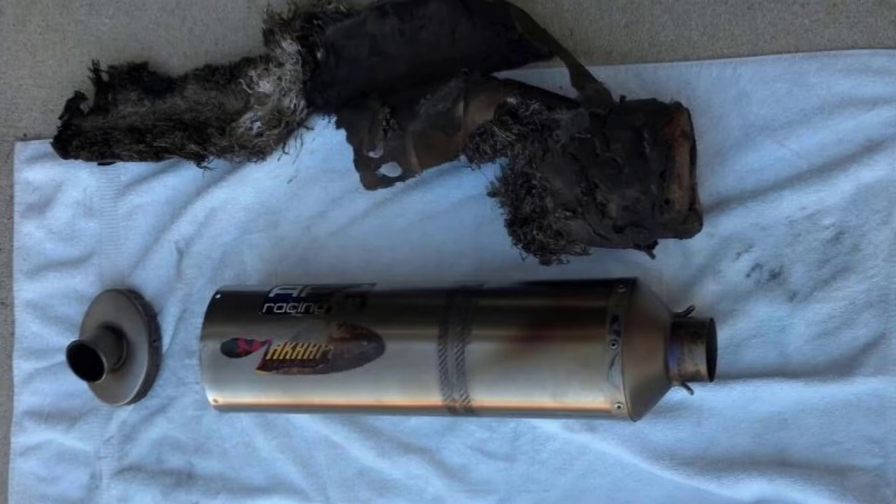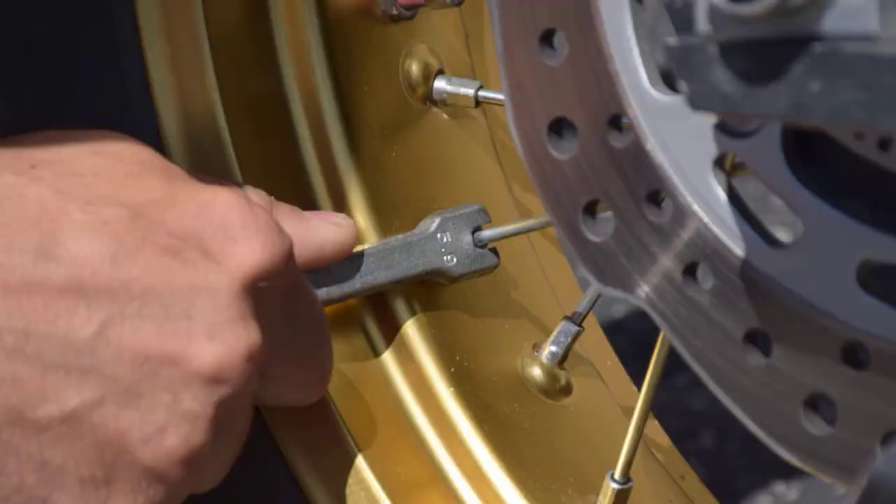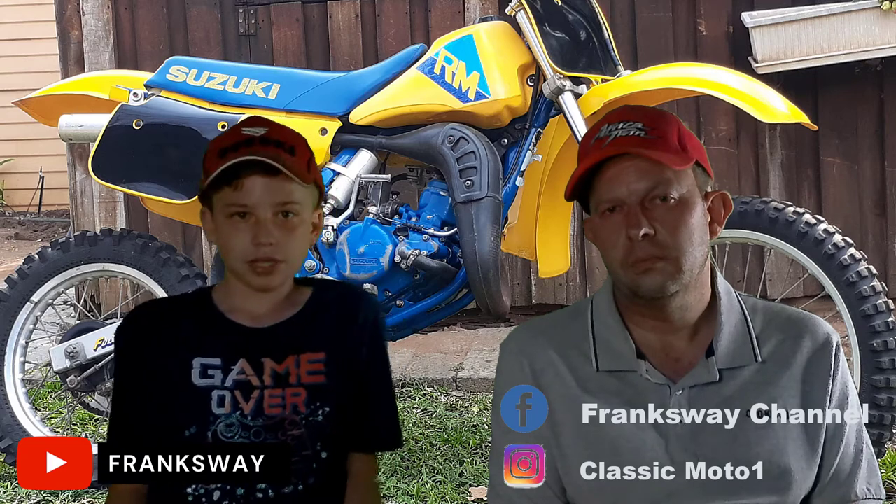Tip number five: spoke maintenance and tightening. First, get yourself a spoke wrench if you don't already have one. The key to tightening your spokes starts with patience — you can't just haphazardly start tightening them; there's a technique involved to ensure the best outcome. We suggest tightening every third spoke, which means you'll go around the tire a minimum of three times. Tighten every third spoke until a light snug is reached, and if necessary, go back around checking every third spoke again.